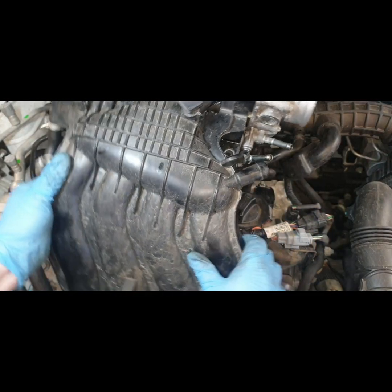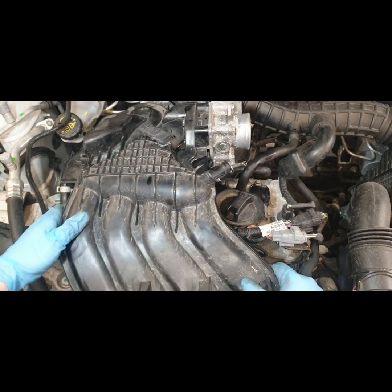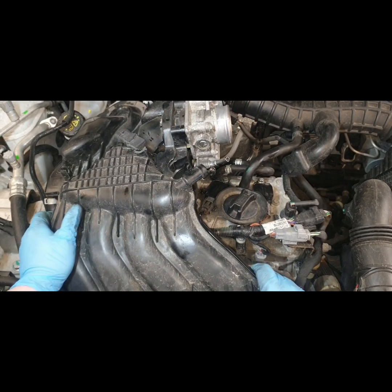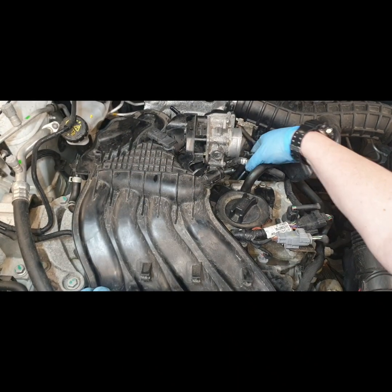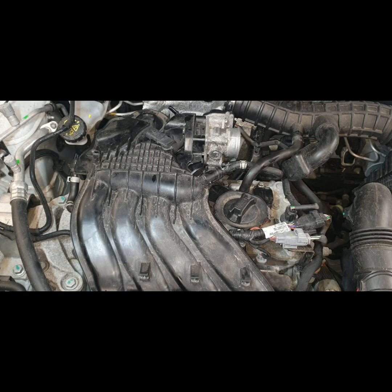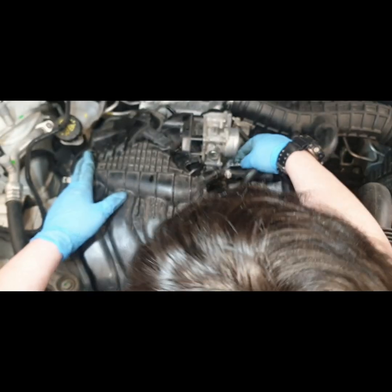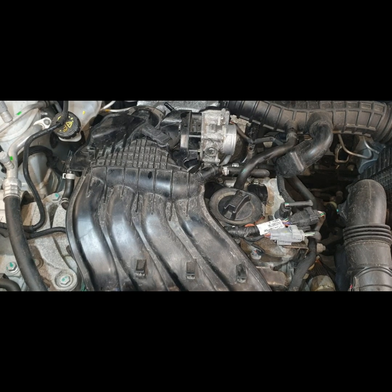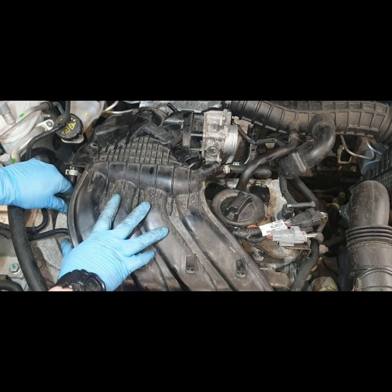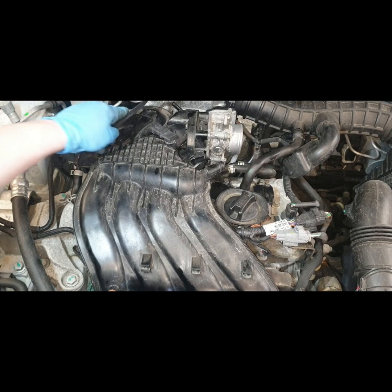Now I've got the big manifold here — let's get it down under there first. That's your manifold sitting in place. These are the two fuel lines, one here and one there. I have seven 10mm bolts holding it in, and there's a vacuum hose over here which has to go back on, plus another vacuum line just here.